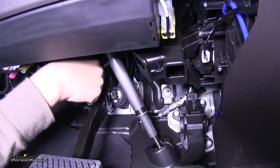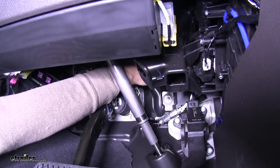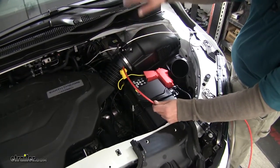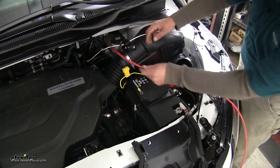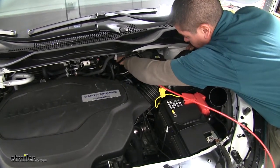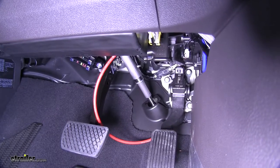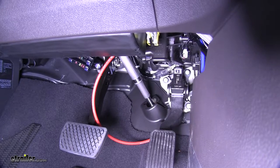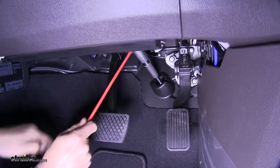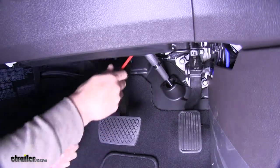Our grommet is going to be right up in this area. Fortunately there is a small cut already in there from the factory so we should be able to pass everything through without having to cut the grommet itself. Again use that airline tube — push it through that grommet until it goes to the inside and you have a good hold of it. Once your wire is through, we can go and connect our white wire and pull it through just like we did bringing it up to the engine bay. With our white wire attached on the outside, start pulling our airline tube in until our white wire comes in on the inside.